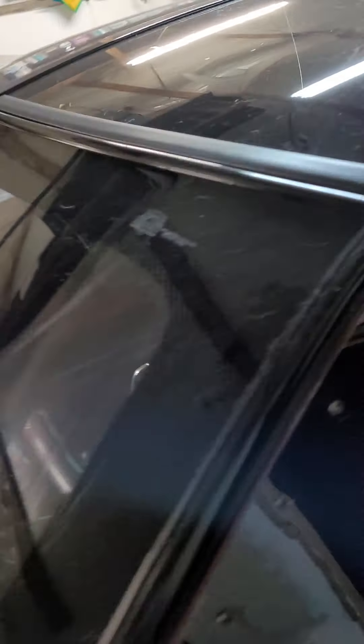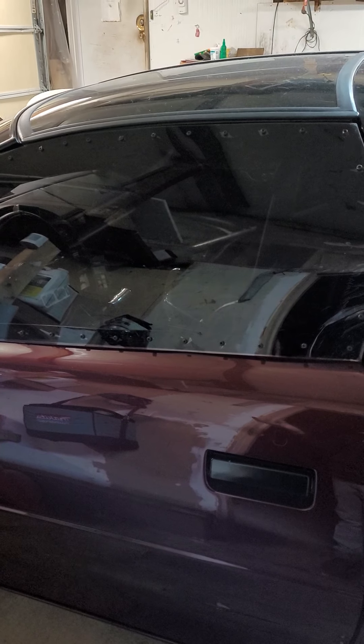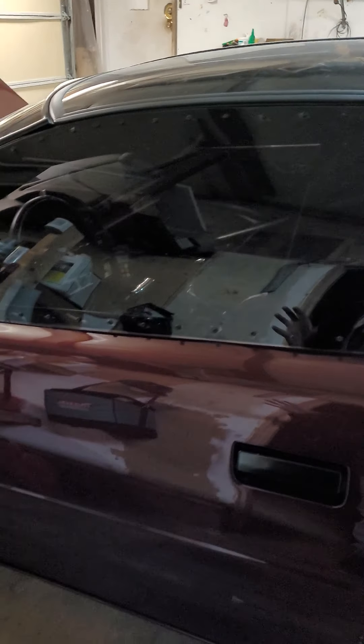It's going to be tough to see, but basically when I hit the pedal it goes down about an inch and you can feel it start to apply. It's a little bit soft — about midway it's fully applied, but if I push really hard it'll go almost to the floor, about an inch off the floor.